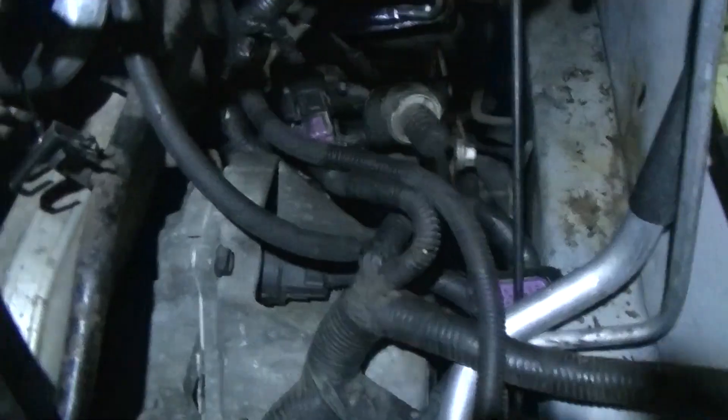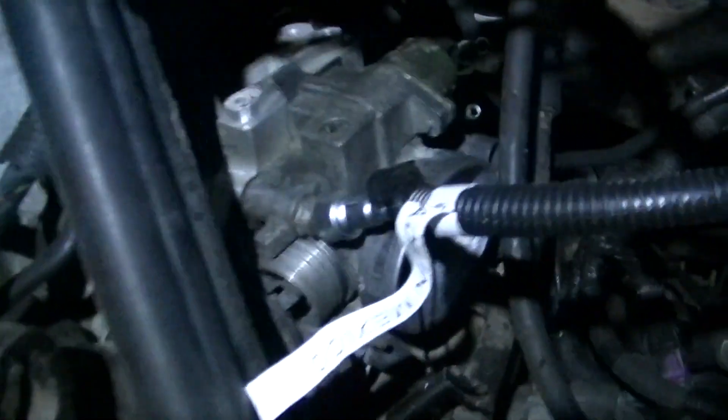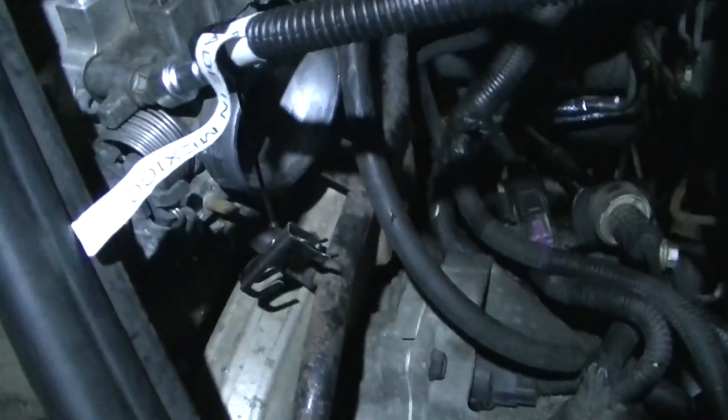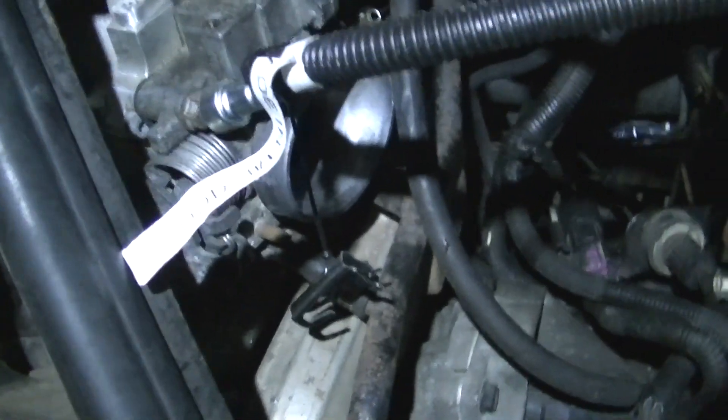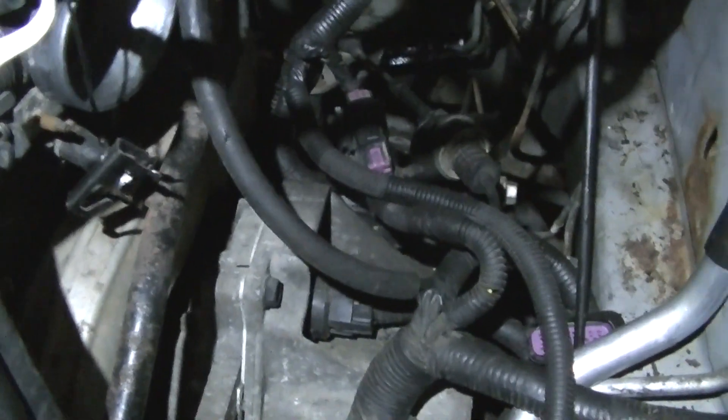You want to remove everything on this side of the motor. You'll have a 3400 — I have a kit that gives me a 3500 but that's a different story. You'll have your throttle body bracket right there, got to take that off, got to take off the intake bellows, and you have to take off your airbox. You also have to remove your ABS module above.